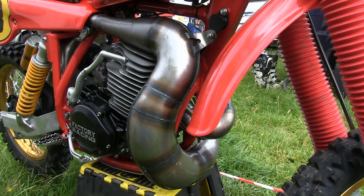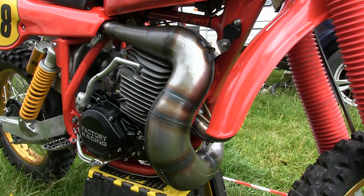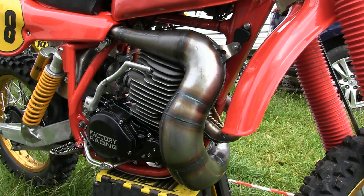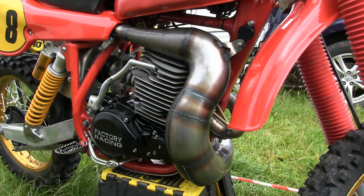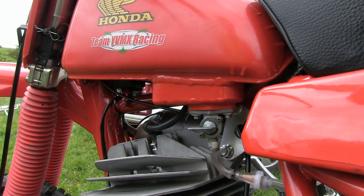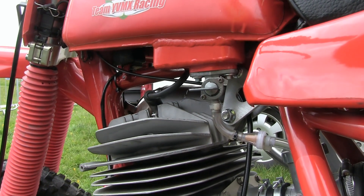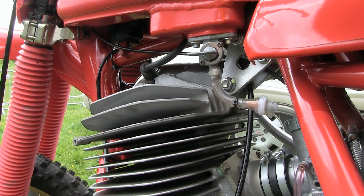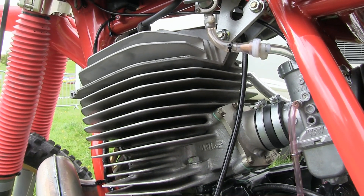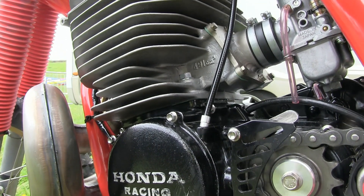In this shot you can just about see where the bike's water pump has been removed and blanked off, as it's no longer required on the new air-cooled motor. Removing all the water cooling parts reduces the overall weight of the bike and can make this into a very seriously quick machine. These type of upgrades on big bore Hondas are increasing in popularity, with many of the faster and more experienced racers opting for this type of conversion.